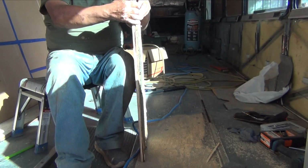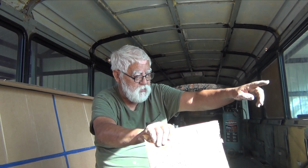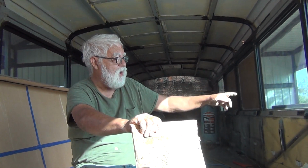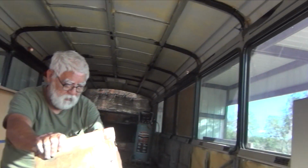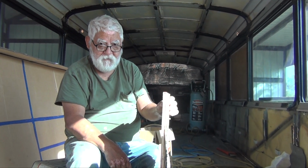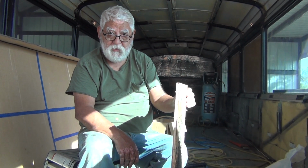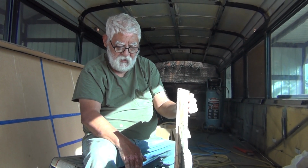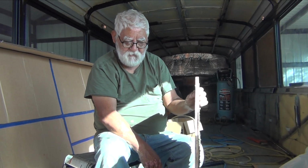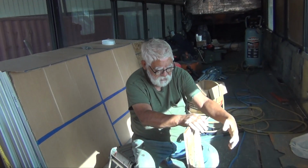So what I want to do is cut a section which, at the end of this first window, is where the baggage compartment starts this way, and it ends at this column. So the baggage compartments are a window wide. I want to cut the metal underneath this way and this way, as wide as the battery, and a little wider so you're not trying to squeeze it in there. Then I will take some 3/4 inch plywood, stand it up and down and secure it to this wall coming in here. This way I can mount the battery to the 3/4 inch down below, facing out that way.